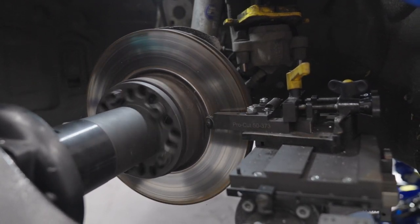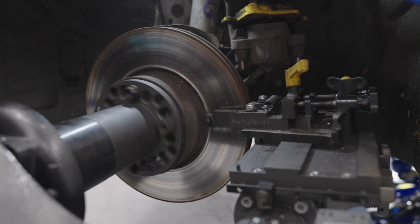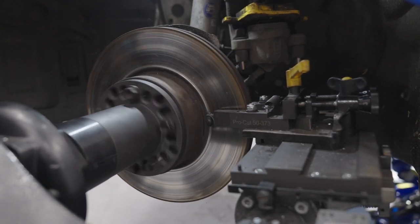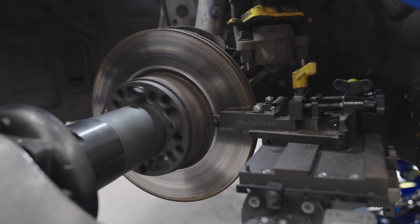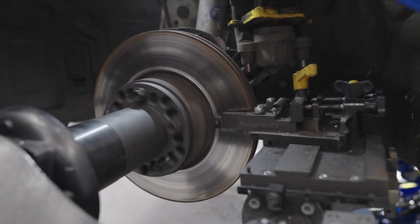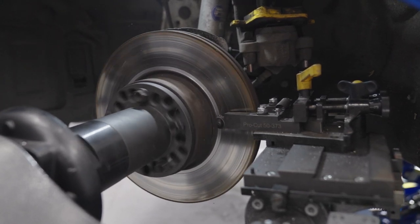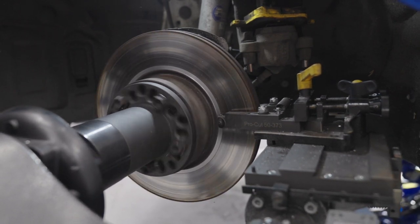The first example is when you have changed the brake pads, but disc replacement is not necessary. Skimming the disc means no bedding in time and perfect braking performance from the moment you first turn the wheel. Skimming can also be used when there is brake vibration due to DTV, disc thickness variation, or excessive runout. Here, using ProCut technology is the only permanent solution.